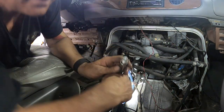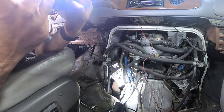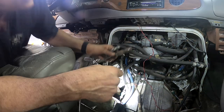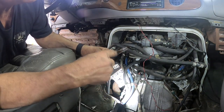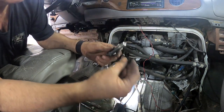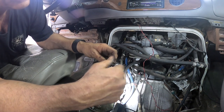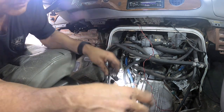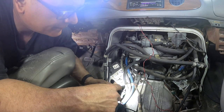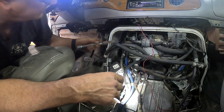Sorry about the poor view, but that's a bust - that is not going to work. It must have just screwed up the tips of the threads going in. So this is the tap I'm going to use - see how it's tapered. And this is the sleeve: when you're done, it screws on like this, all the way up, and you just screw the plug into the hole. You do have to put some blue Loctite on the outer part of the sleeve.